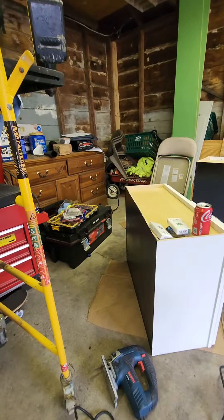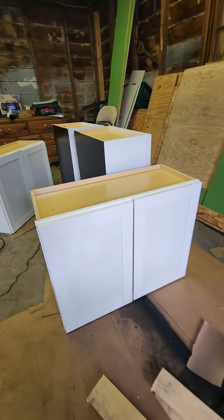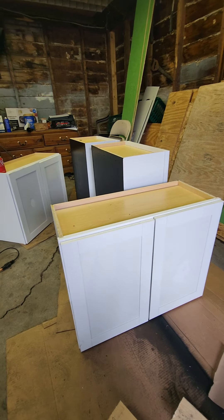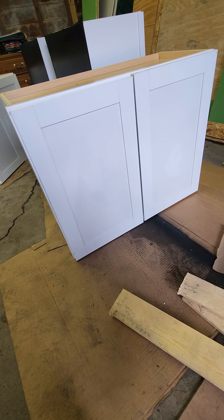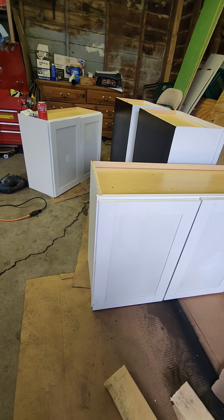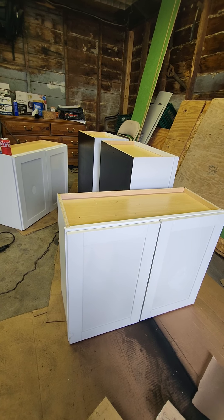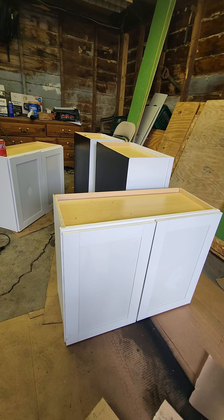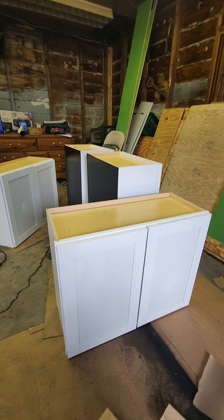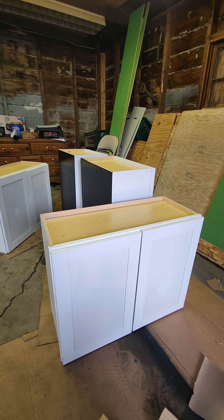The backs of these are painted black because when they go up against the windows that I had tinted extra dark, when the sun hits you can still see through. Door knobs and magnets are keeping them shut. I'm also gonna have to reinforce them — these are just cheap half-inch particle board. But doing what we're doing, I got liquid nail, we're gluing them all together, bolting them all together, bolting them to the bus. It's gonna be strong. I'm trying to make something good out of something cheap.